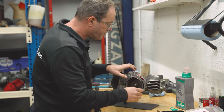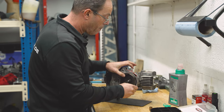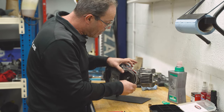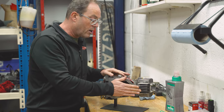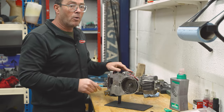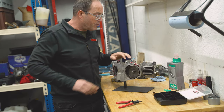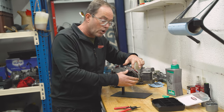Click click click — that's good. Let's check again. I still have a little bit of tolerance but it's feelable and almost not seeable. The axial tolerance is also very little now. We need a little bit of tolerance of course — you can't make it too tight because the clutch bell needs room for turning. But wow, it's almost perfect, and it all turns freely.